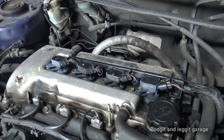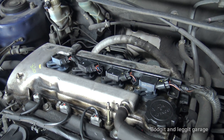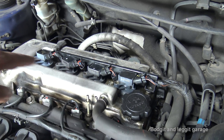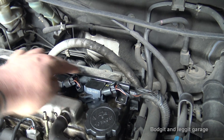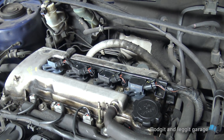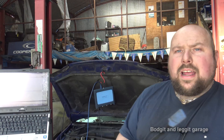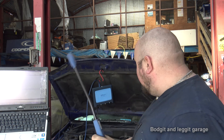You can see in the middle — those are the two genuine coils and the two on the outside are completely different; they are spurious. All I've done is loosened the bolts so they're still plugged into the plug but kind of loose. We're going to switch the car on, set up the scope, and see what's going on. I'm going to put the probe on top of the coil pack to get a good solid connection, and then we should get a waveform up and I'll tell you if I'm on number one, two, three, or four.